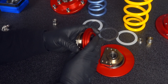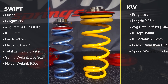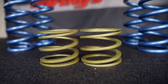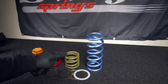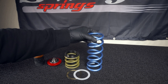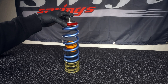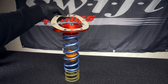As far as height, the 60mm perch is about a half inch higher than the OEM version, with the new spring 2.25 inches shorter than the KWs, and the helpers taking up anywhere from 0.8 to 2.4 inches. When we install this on the strut, we'll start with the helper spring, followed by the metal thrust sheet, the spring adapter, another thrust sheet, the main spring, bump stop, a third thrust sheet, the nylon shim, then the spring perch — all of which will get pressed into the top of the camber plate with the gasket on top.